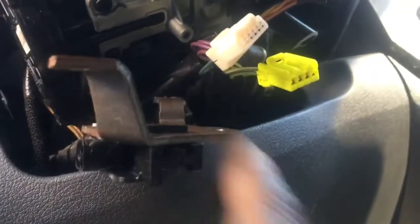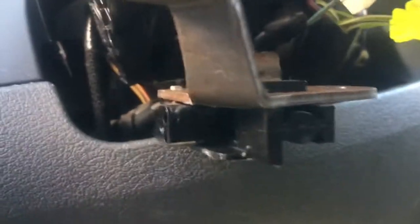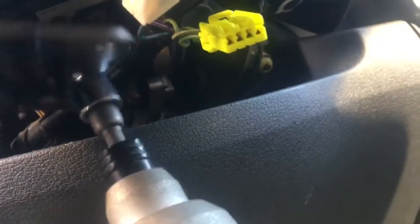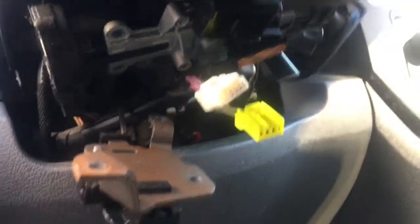The bracket is down — that's the tilt bracket right here, so that's out of the way. That gives us access to those two bolts, and those two bolts are what's going to allow us to move the ignition switch. I'll go ahead and remove these two black ones — that's one, and that's number two. They're the same length.